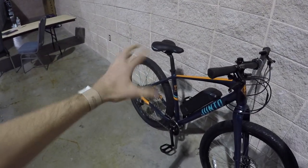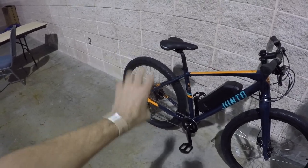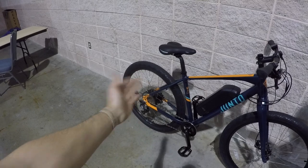Philadelphia has interesting terrain and topography where you sometimes have to make very quick decisions and climb very quick and steep hills. About 60 newton-meters of torque is what we were talking about — that's pretty great for a hub motor. One trade-off of a hub motor is unsprung weight, but there's no rear suspension here. We actually weighed the bike from the saddle and it tipped forward. When making this bike, Sam comes from a background of mountain bike racing and appreciates a good front center — being planted between the wheels rather than on top of the rear one allows more weight on the front wheel for traction and a confident feeling on the handlebars.